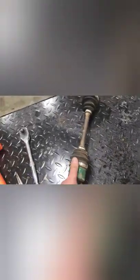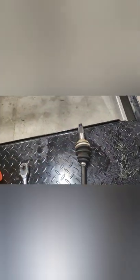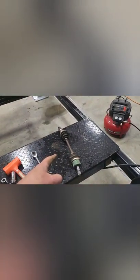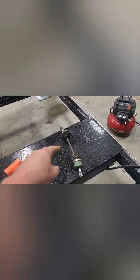New wheel bearing needed. This side's CV shaft is maybe just a tiny bit stiff, but this other side's nice and loose. Probably okay? Should I replace them while I have them out? Let's go price them out and see. Come over to this side — this CV shaft is nice and loose and doesn't seem to have a bunch of slop in it. This other side's really stiff though, so probably going to price out replacing those.